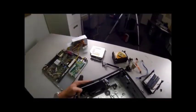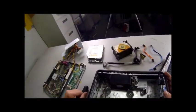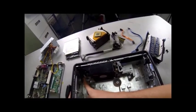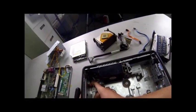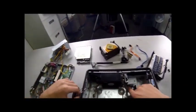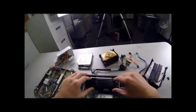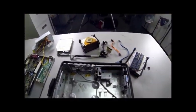That's it — we've just completely disassembled the Dell. Last but not least, we have our fan. This one is real simple to remove. Before we can take that latch, we have to remove the ribbon cable here — there's a loop that's black that you pull out and up out of the way. Now it's all connected to the front here. There's a little latch — pull on that, pull it back, it will rotate out. Pull it like so — it's up and out.